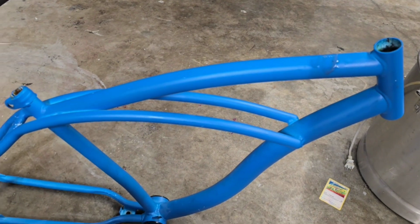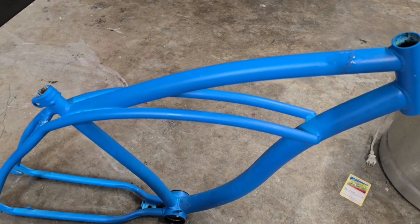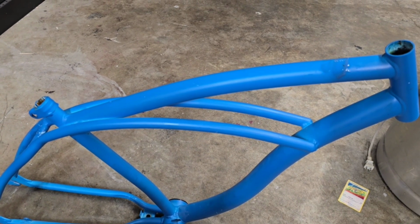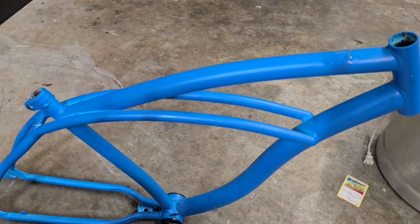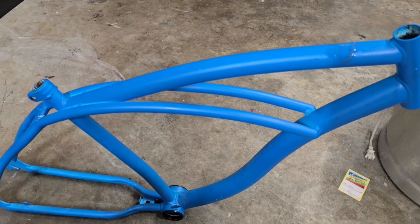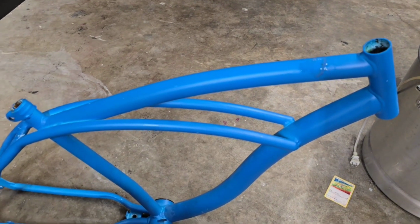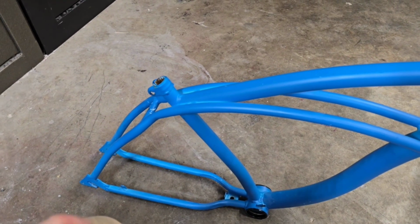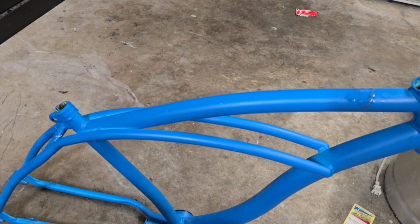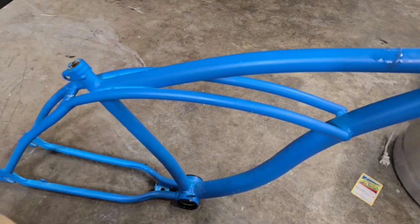I haven't painted a whole lot. I've done a few things, but not a whole lot. So I'm probably just going to strip this down, get all the paint off. Then I'm going to primer it, probably white, because I want it to pop as loud as it can. If you do a white primer, you'll get a definitely brighter color, versus if you do black, you'll get a darker color. Then you've got your gray. So I do know a little bit about paint, just not a whole lot. Like if I start getting drips, I know how to correct it: you probably just have to wait for it to dry, then sand it and redo that piece. But I'm going to try to be very careful with this.